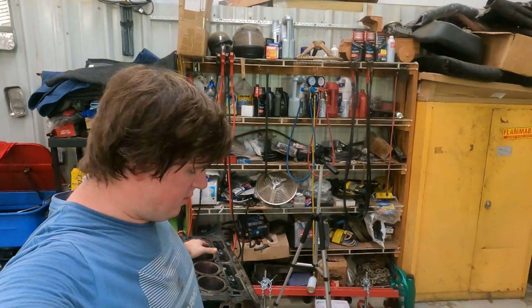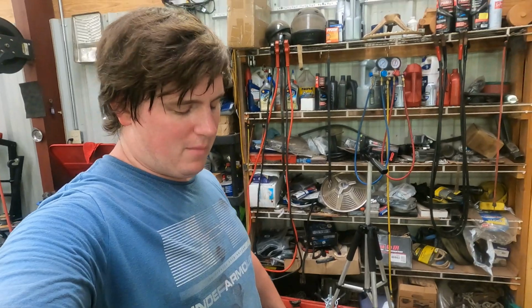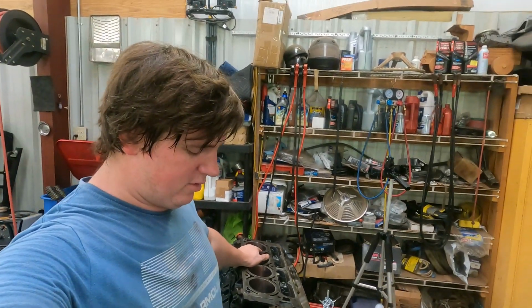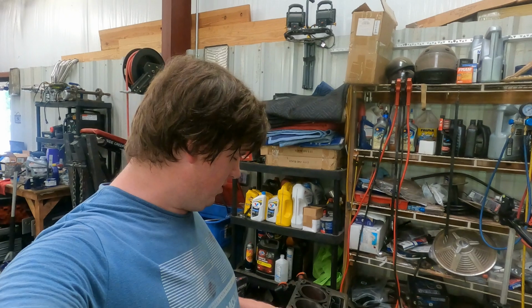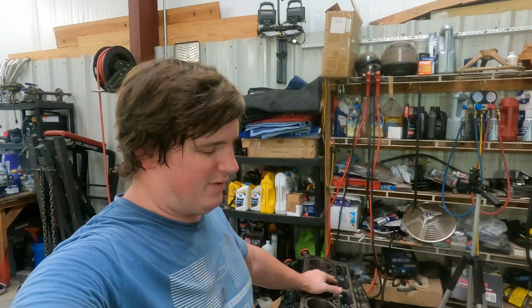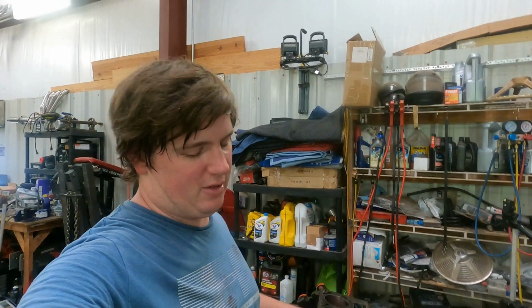All right. Well, we got 4 pistons knocked in. Got all the bearing measurements taken. I'll post those in pictures. I didn't do it on camera. But we're anywhere from 15 to 20 thousandths. So perfect for me. I like it. Some people want tighter, some people want looser, but I'm going to be 15 to 20 on these LS motors. Factory calls for, if I recall right, 11 to 25. So that's it. I'm good with 15 to 20.